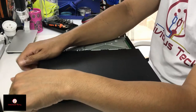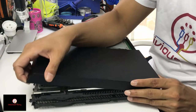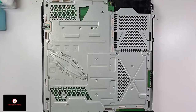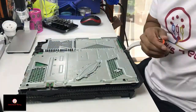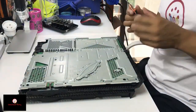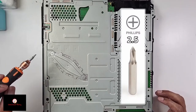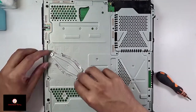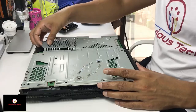Just grab it at the end here and then lift it up. Next, take off all the Torx screws going up around the PS4, then take these two screws off using a Phillips head. Now let's disconnect the fan connector here and then we can lift this off.